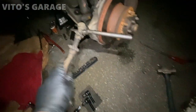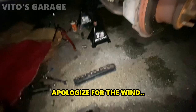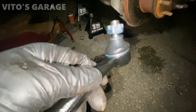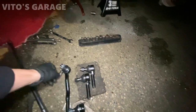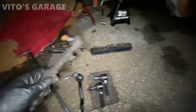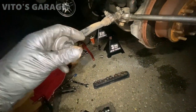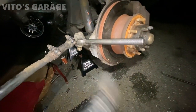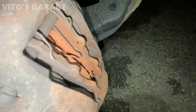This side is giving me a lot of issues - it does not want to come loose. These are all new tie rods I've prepared. What I did is I moved each boot and added a bunch more grease to it - I always do that to basically every car. The other side's tires are pretty loose too, it's not good. It also has brake problems - this caliper is trash, it's heating up the rotor and the brake pads are uneven.